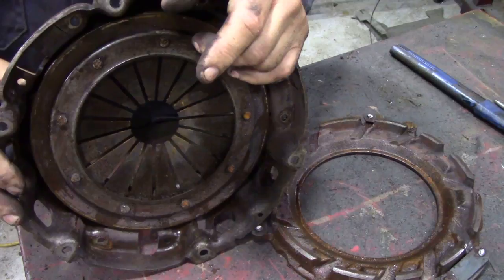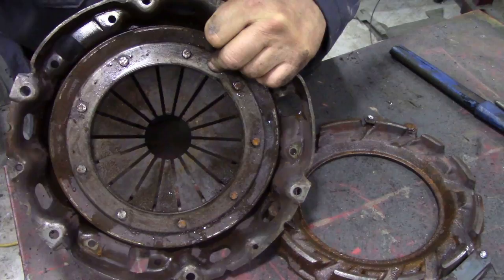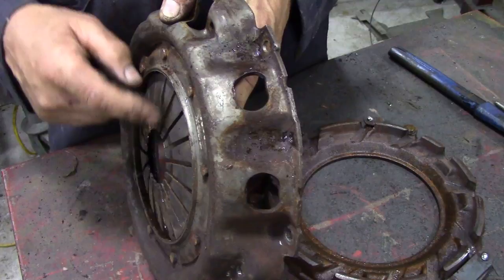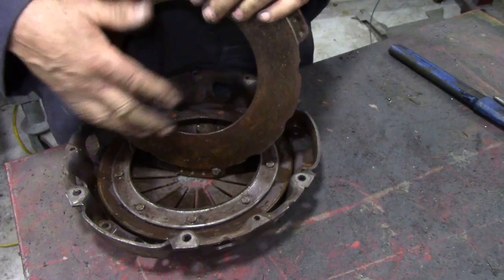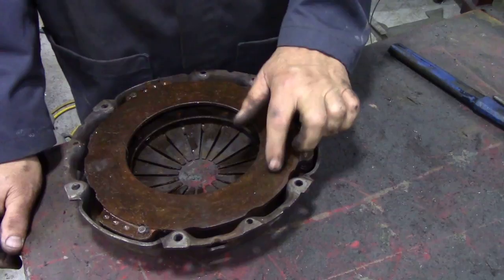Very rarely do these bolts or rivets break off. And it's such an easy job to do a reconditioned clutch. The only damage, really, with the clutch — this is off Charles' clutch, where the bearing had overheated and the fingers were out. All you need to do is drill out these rivets, change the plate, put the rivets back in. Put this on the machine and remachine this surface. Then simply put it on, put the rivets in — job done. That's a reconditioned clutch. You just have to make sure that this face is the right height, and that's it.